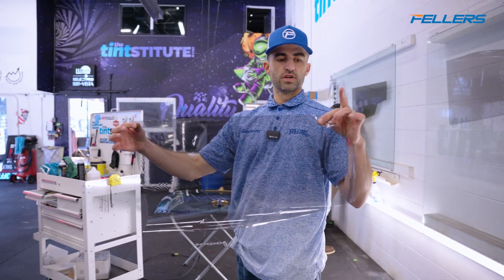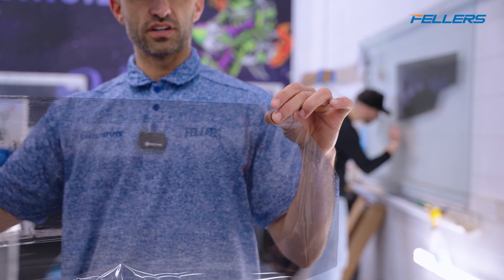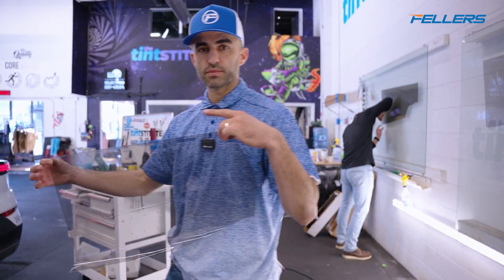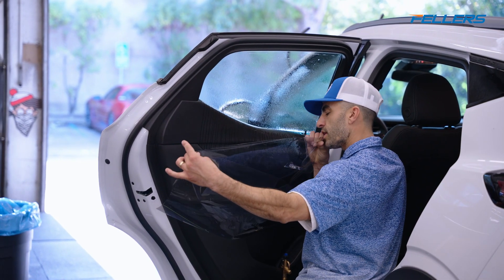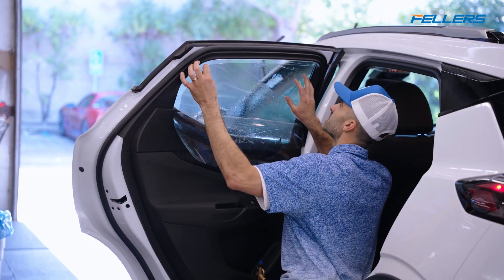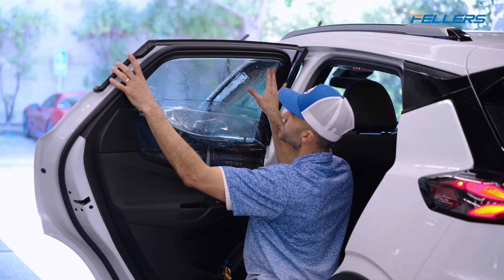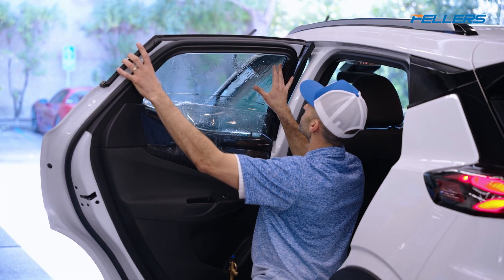I'm going to hold this film with my middle finger. When I pull the liner down, it's going to hit my middle finger, and then I switch to my pointer finger. My pointer finger is the only thing that's ever going to touch the adhesive, which is why I'm going to lick it. I hold the template off to the side, rub my fingers together, pull the liner straight down — it hits, I switch, and this hand goes behind the film. This is unique in the sense that this customer wanted 50% on the back half — it's for the city of San Luis Obispo for heat rejection, not privacy or glare, so it's going to work just fine.